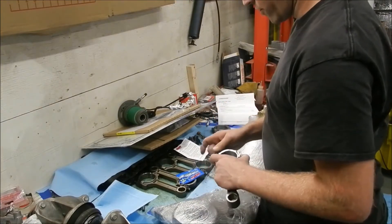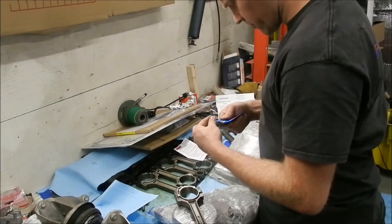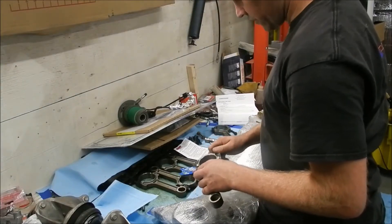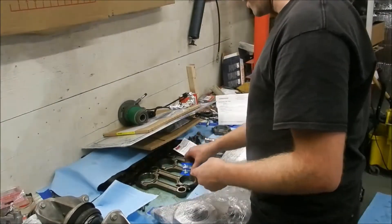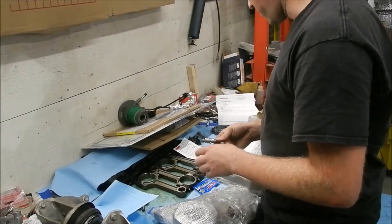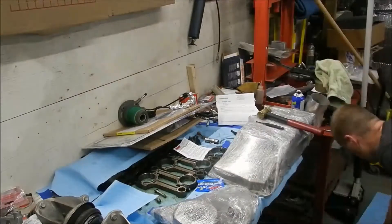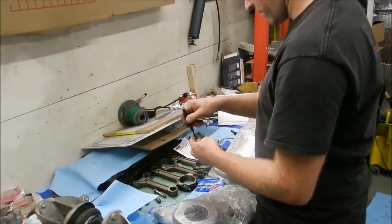The reason that's really there is more for people who are pulling their motors apart for refreshes quite often. This is probably going to be the last time this motor is put together — it's not likely it will be taken apart more than once. The bolts are not likely to stretch in that time frame. I have had some motors where I've had to take them apart several times and I've just tossed the bolts. Since I don't have the stretch tool, after like three refreshes I just get new ones. I'd rather not risk it.